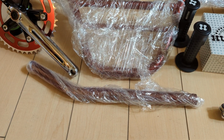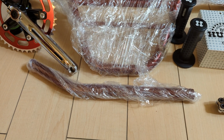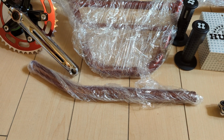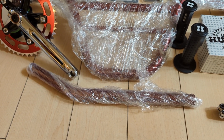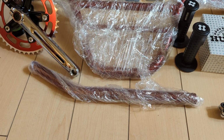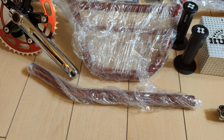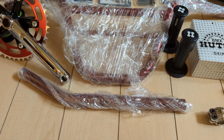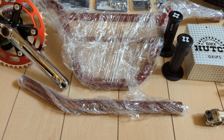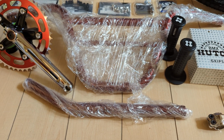And that also brings up the point of running into the seat post problem. As you know, with some of the old bikes and some of the newer parts and the repop parts, they don't necessarily match up that well. So case in point with the seat post, if you've got a 7/8 or a 22.2 millimeter, I mean, if you've got a Hutch Trickstar, depending on the year, or even if it's one of the newer ones, that may not actually fit. It may not work.